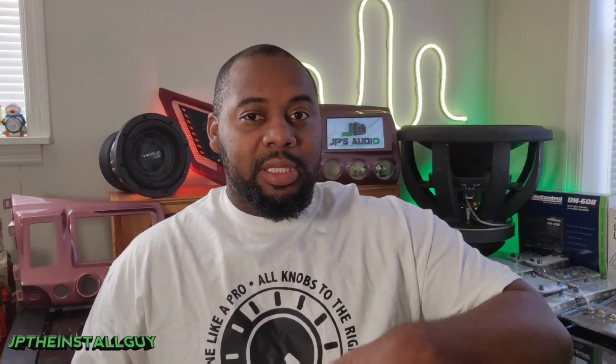Now, just because you got clean signal coming out of the head unit into the amp and out of the amp to the subs doesn't mean that you still can't blow your system. You still have to protect your system. And what I mean by that is when you first get your subs, all those components like the soft parts are going to be real stiff. So that's why we usually tell people you need to have a break-in period.